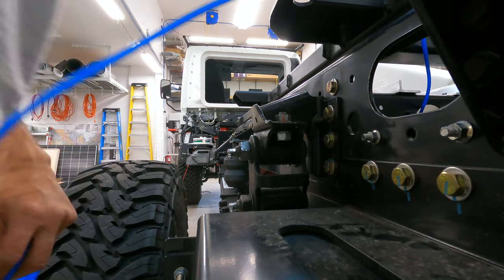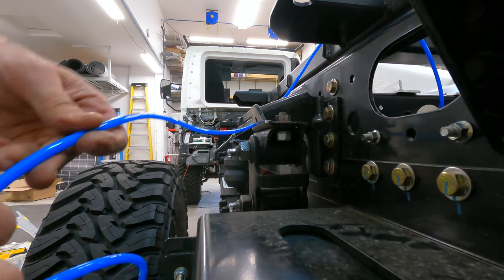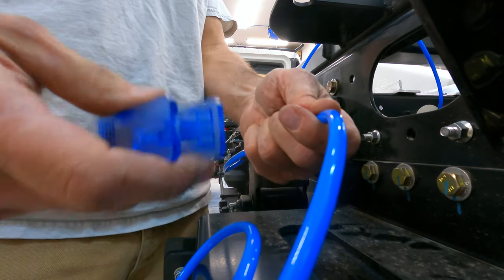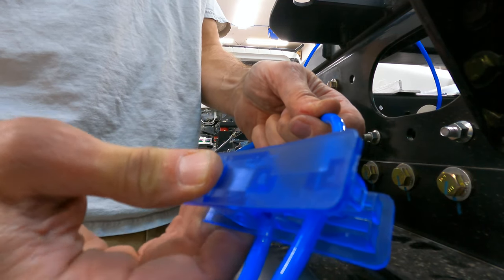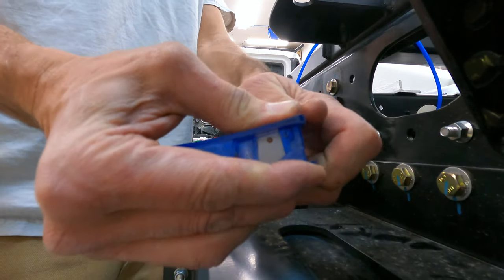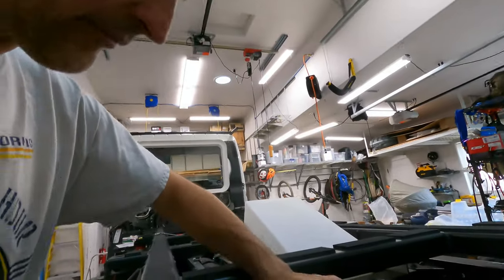The airlines also interconnect the two tanks. One thing I noticed with these airlines is to make sure you get a really clean cut. Cutting with scissors often results in a slightly angled cut, so make sure to use an actual airline cutting tool like I'm using here. They make these tools for different diameter airlines. That way you get a straight cut and the push-to-connect fittings seal up well, ensuring a good tight fit with no leaks — since air systems notoriously tend to have leaks somewhere.